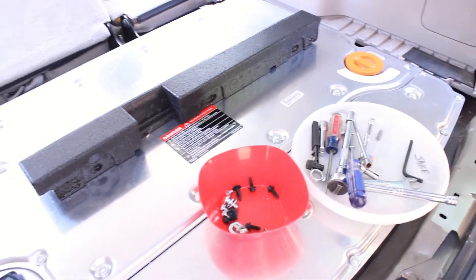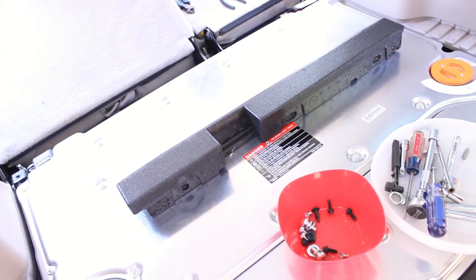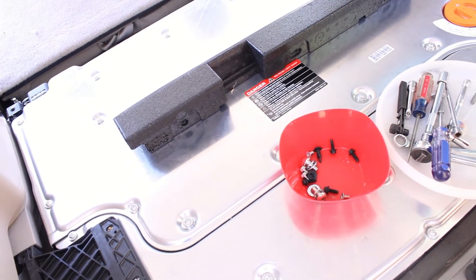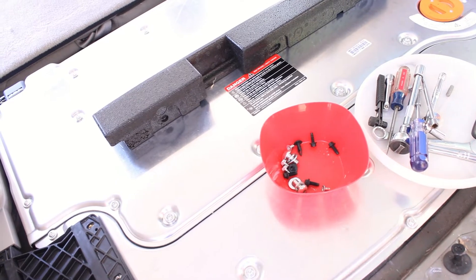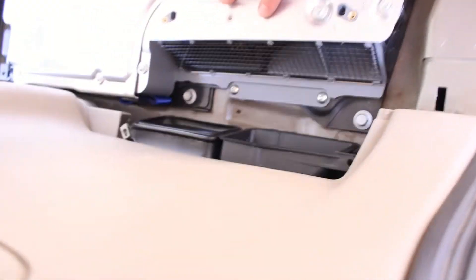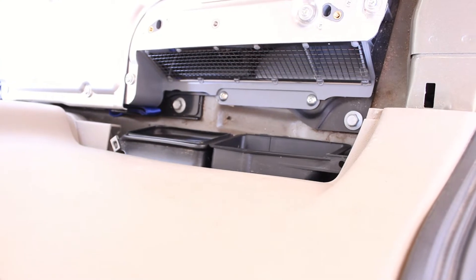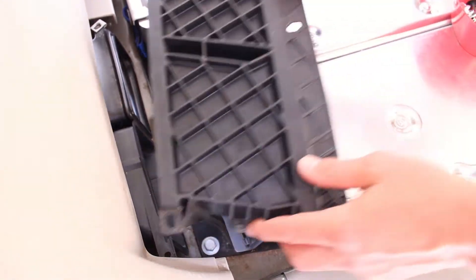We're done. We got the charger up to about 351 volts — I waited for it to max out. I couldn't find a published voltage for the 2009 Ford Hybrid Escape anywhere; it said 300-plus in multiple places, but 350 seems to be the magic number — 175 volts per bank, top and bottom. We put everything back and it started up. I want to point out the fan system for cooling: one side is sucking in, the other is blowing out — that feeds the air intake and exhaust from the side of the car. Before putting everything back together I tested the fans and they worked — I was surprised how loud they are.